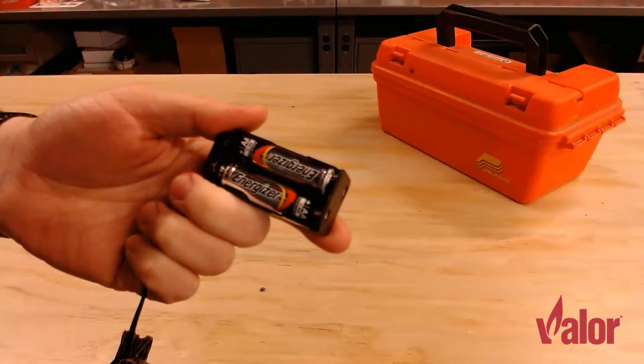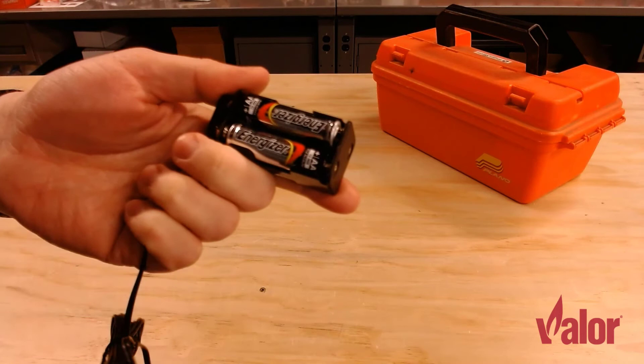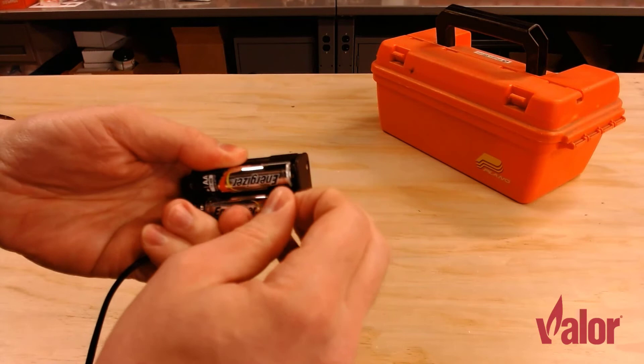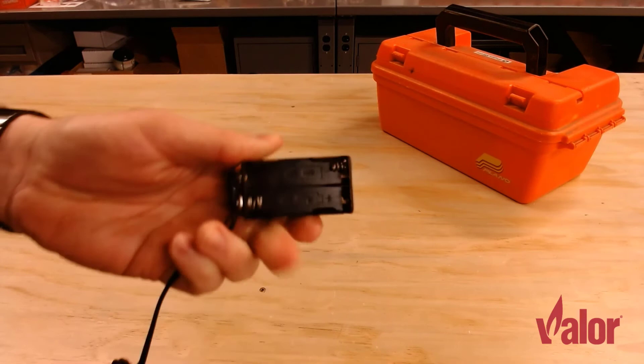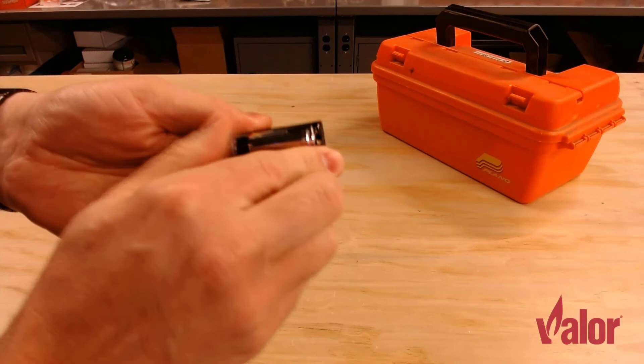The other kind of battery holder is this style, which is a 2x2 stack — two batteries on the front and two on the back. You'll notice there's no removable cover on this battery pack. To remove the batteries, it's the same technique: pull out the positive end toward the spring and lift it out. Do the same in the other direction and then do the same on the other side, removing those two batteries as well. When you're ready to replace them, simply put the negative end in first and push the positive end down, and do the same with all remaining batteries until all four have been replaced.